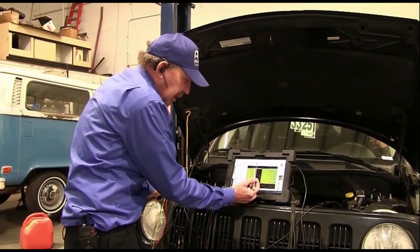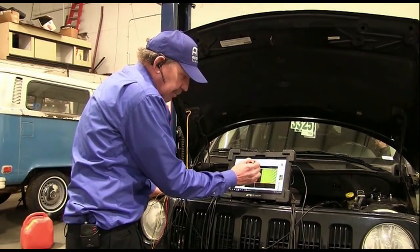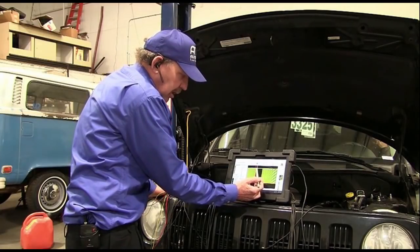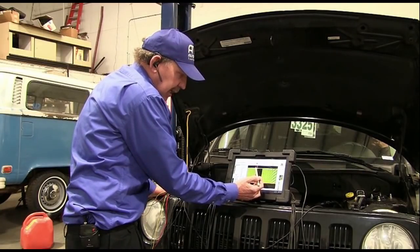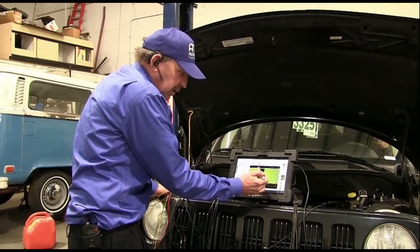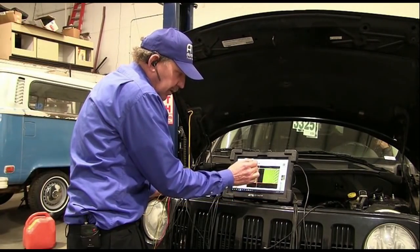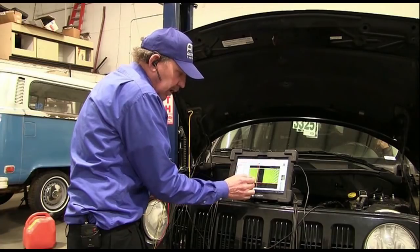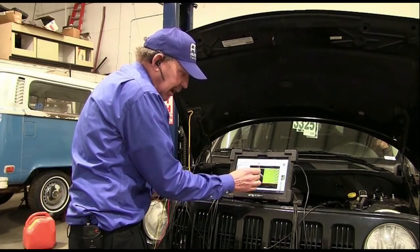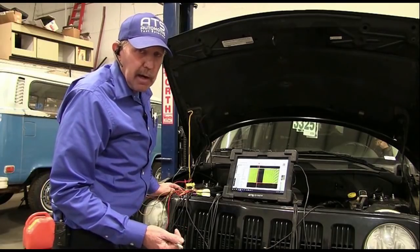The computer sent the signal. The sensor is failing because it's getting hit by ignition spikes. And then the circuit can't work. The ICs inside that crank sensor can't work, and it can't pull it down once it takes the hit from the spike. Right here, you can clearly see where that coil, the number one coil right here, hit that signal and knocked it offline, and it can't work. Integrated circuits don't like spikes.